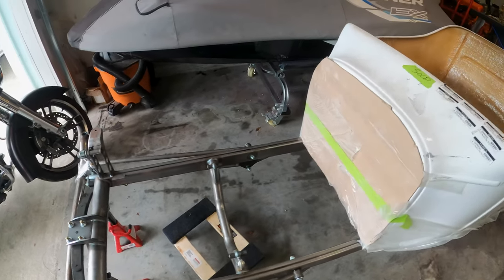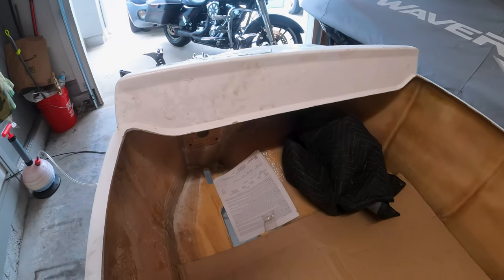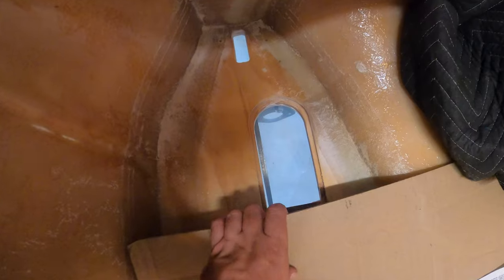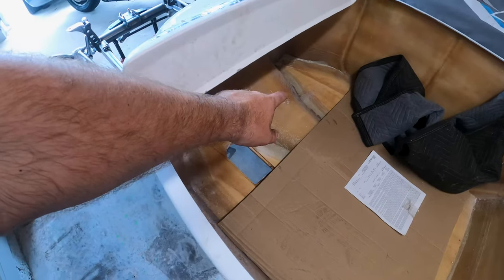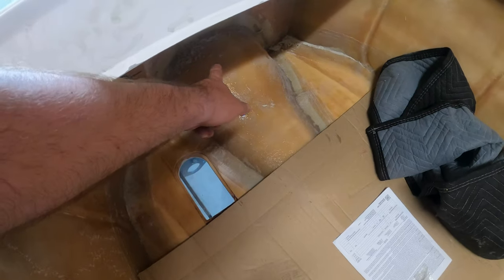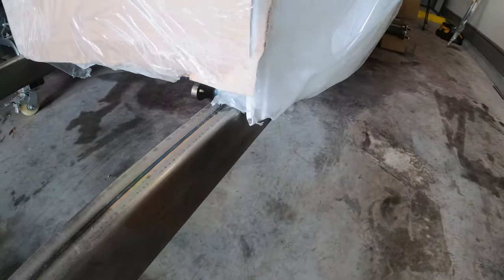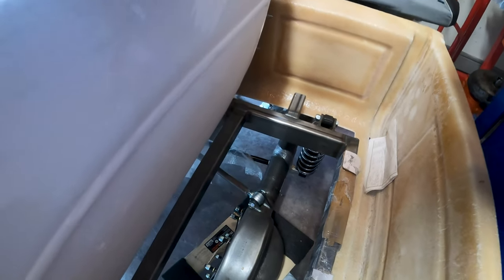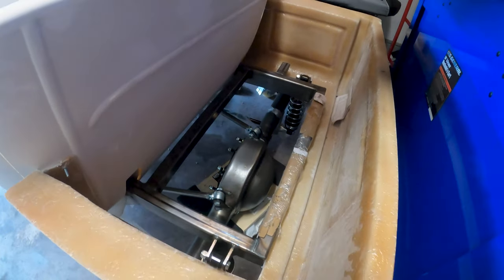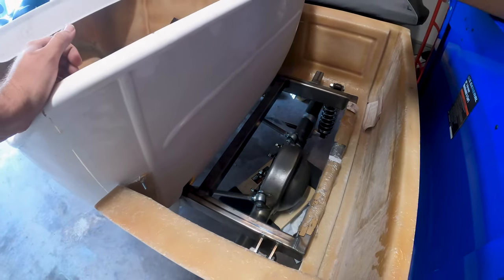So I know this is the part you guys have all been actually more interested in. So let's take a look at the inside of the bucket. I was actually concerned that it was going to be a lot smaller. I'm a pretty big guy, so I'll fit in here actually just fine. But all the holes are cut there in the steering rod, so everything is ready to go pretty much. Transmission hump is already installed. You can get these without, but just pay the extra couple hundred bucks and get the floor put in. This is a channeled body, so it sits over the frame and you get a little more overhang, which is pretty nice — more of a modern look to it. Now on the rear end, you can see that they actually already installed it, but they did not tighten everything down. So everything is pretty much in there and ready to go. It's almost like it's just short fitted together to show you how it's assembled.